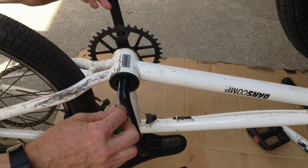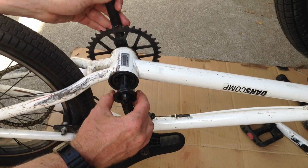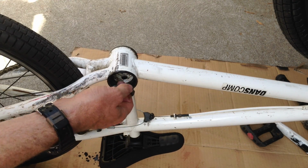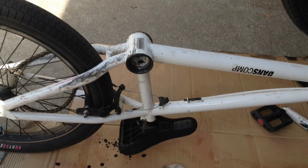and this part you turn clockwise using a screwdriver and the little grooves on it. So you just loosen that up, take it off, and then just sort of twist that thing out like that. This part where the bearings were riding is just pressed in there, so we just need to bang it out of there with a hammer and some kind of either wooden or metal punch.